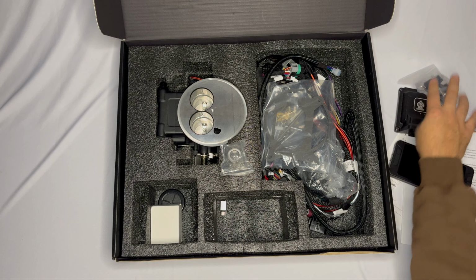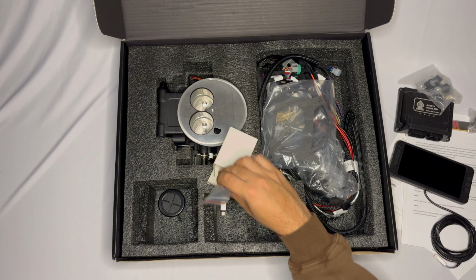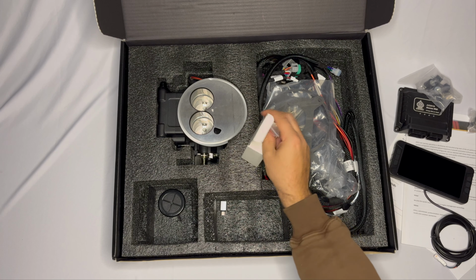And yeah, temp sensor. It's a temperature sensor for your coolant. Always gotta have one of those. I think the one that I have on there right now actually will work with this. If it's an even better thread fit, then perfect. Because back in the day, the Mazda B2000s, well, at least the 83 model, had some weird threads. Now, I like this. Now I can bore out where my original wires are coming through for my kit that I have on currently, and I could replace it with this. This is nice. They really went above and beyond packing these things.